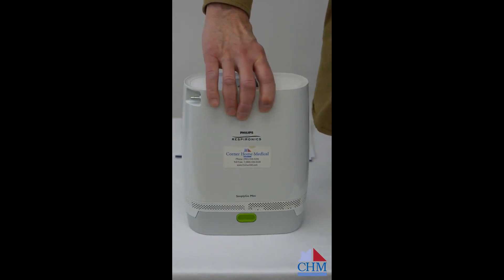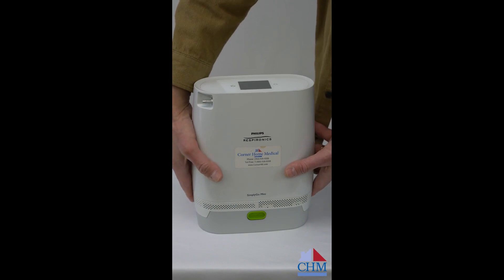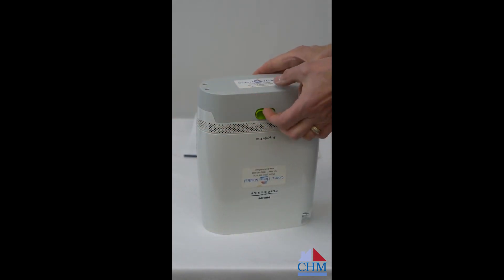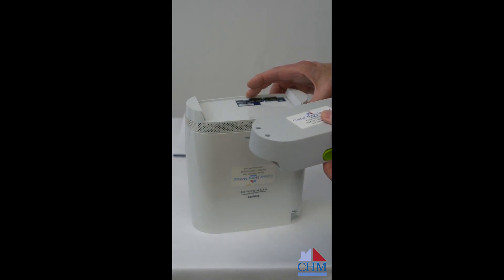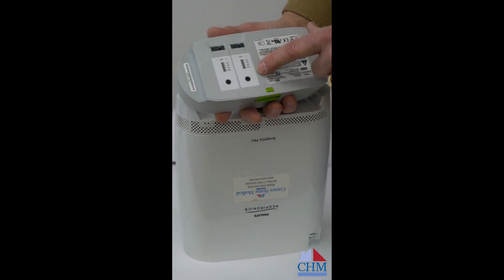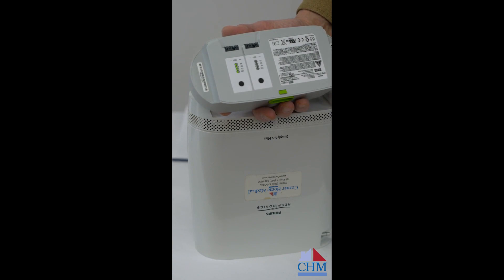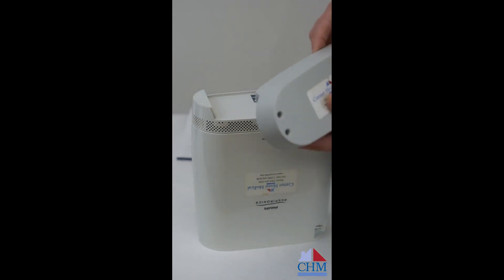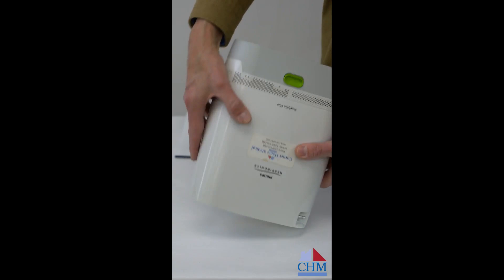Let me show you the battery. Batteries can be exchanged — you can rent extra batteries for these units. This one comes with just one battery because it's the extended use battery. To take it out, I'm going to tip the unit upside down and show you the release. It's a matter of pulling up on the release and then sliding the battery out sideways. You can see I've got a two-cell battery with indicators I can press — the light comes on showing 100% for both cells. There are actually two cells in the one battery, which is what makes it an extended use battery. I can slide it back in by lining up the grooves, snap it into position, and then I'll show you how to use it.